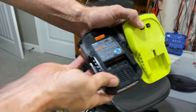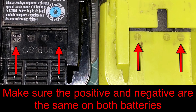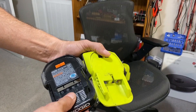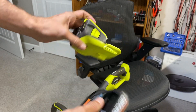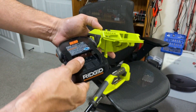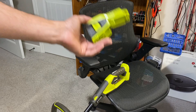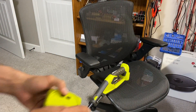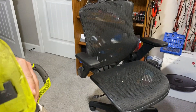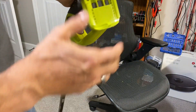When I took a closer look, the clips are in a different spot. I took the covers off the batteries because it's a lot safer when you're modifying the blocks, especially since these are right where the pins are. I don't want to mess up the Rigid at all — I want to keep the Rigid batteries clean. But the weed whacker is 10 years old, so I don't care if I cut a little section out. With the blocks off it's easier to see. I measured everything out and made sure all the pin alignments were the same. When measuring pin distances, use a plastic piece — you don't want to short them out.